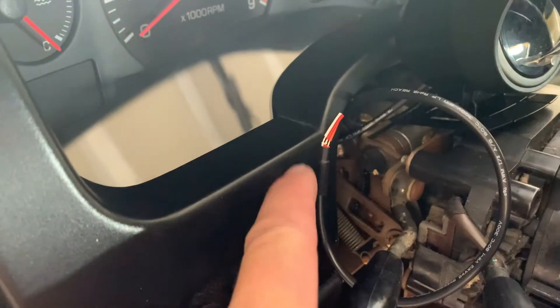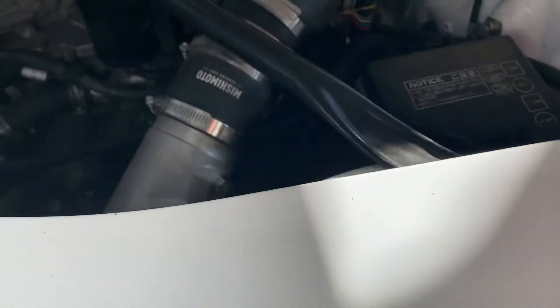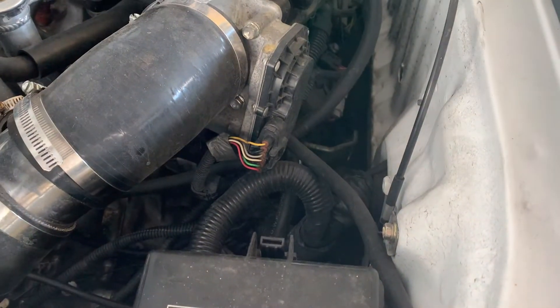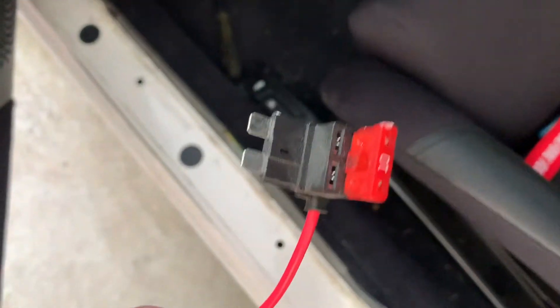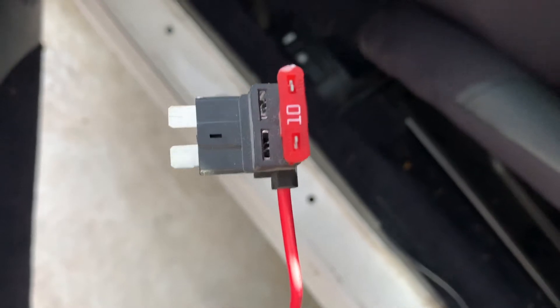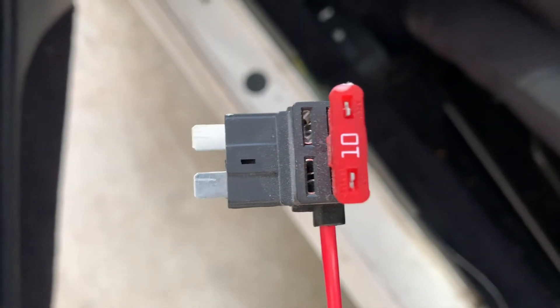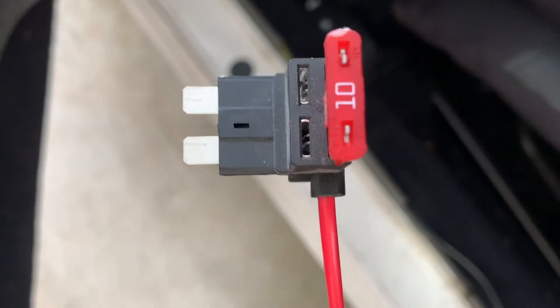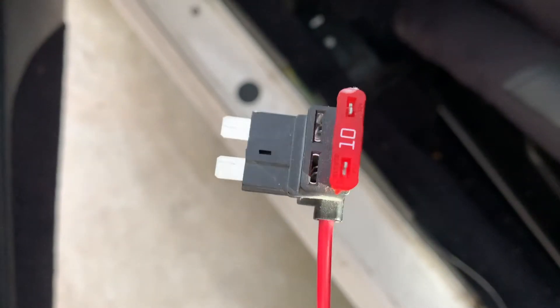These wires are going to be what you hook up for power to the gauge. The other wires I've got running down are going to come out below this kick panel and extend all the way back down to the drain plug. This makes life way easier — it's called an add-a-fuse or add-a-circuit. Basically, you go to your fuse box, remove a fuse, and put this in place. Then you'll have space for two fuses — one for the original circuit and one for the gauge fuse. A 10 amp should be just fine for the gauge.